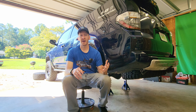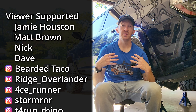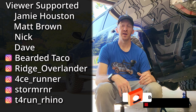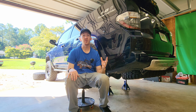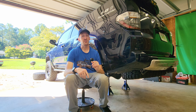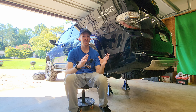I put the driver's side on the driver's side — I didn't film the passenger side, it's the same process. Quick shout-out to my patrons — thank you for your support, it means a lot. If you'd like to be a patron, head to patreon.com/timthetrailman. Both sides are bolted up, wheels are going back on. I had not been trail riding while the bump stops were off — if you are missing bump stops, do not wheel your vehicle. It will destroy your axle or shock; the bump stop is there to limit that up-travel.